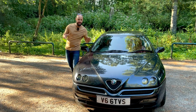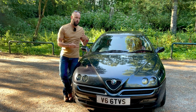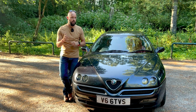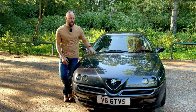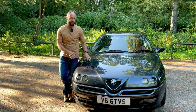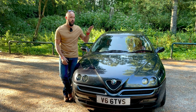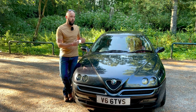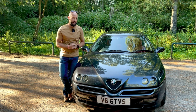So what is the plan? What do I intend to do about it? Well, if there's anybody who knows a thing or two about Alfa Romeos, it is Alfaholics. I'm sure you've all heard of Alfaholics. They are wizards with Alfa Romeos. Back in the day, they do insist that the very best setup for these cars is actually the Koni Sport front shock absorbers, OEM rear shock absorbers, and OEM specification springs, coupled with the up-rated anti-roll bar kit.